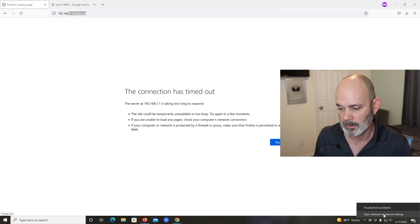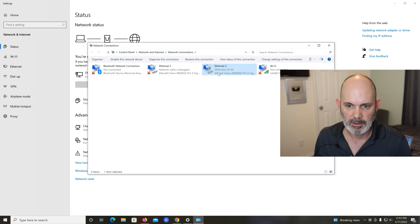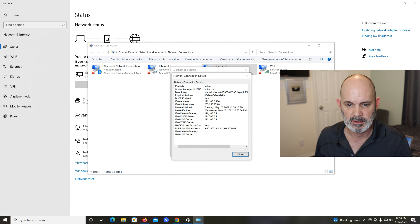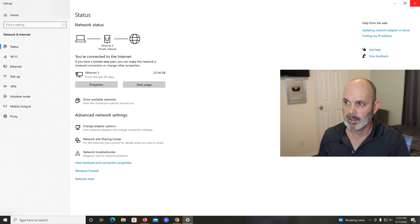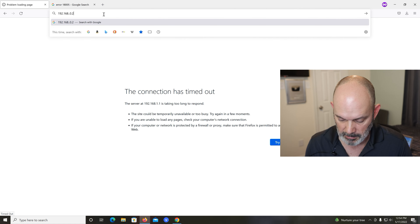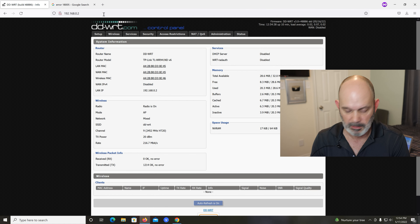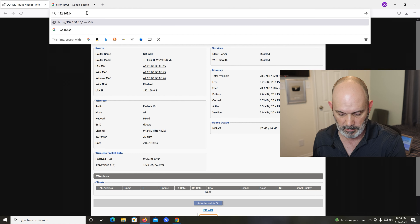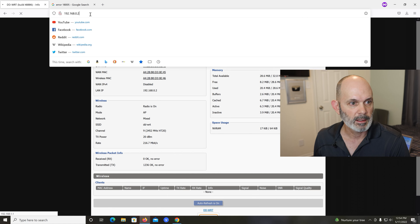You can see that now I have three ports left over to use — as opposed to the other video where I had two ports left over. Any of the ports on the back can be used to connect an Ethernet device. At this point I should have an IP address from my main router. Just follow these steps and it will work. Go to Change Adapter Options, right-click, Status, Details — you can see I have a default gateway of 192.168.0.1, and I have an IP of 192.168.0.184, meaning I'm connected to my main router. Navigate to 192.168.0.2 — the address we gave the switch — and there we go, right to it.